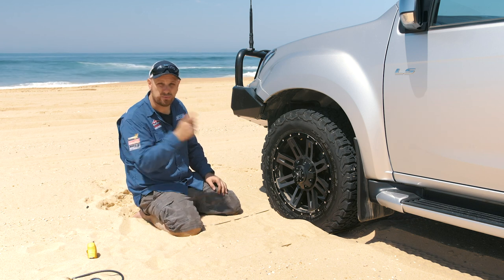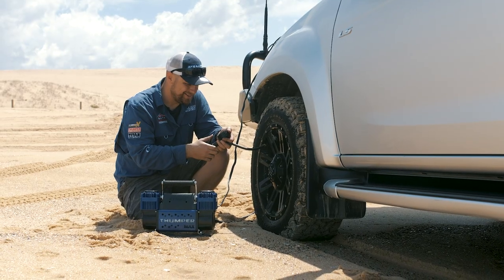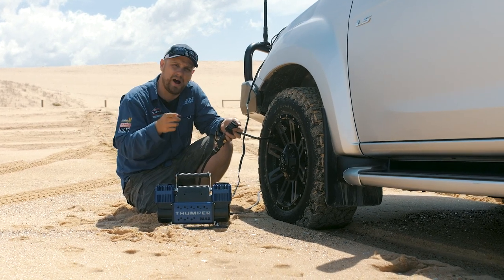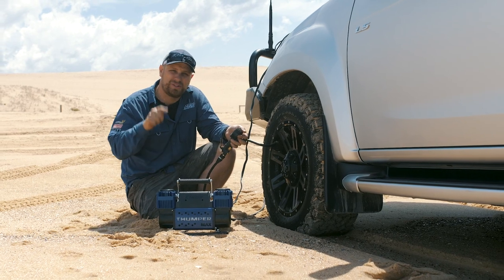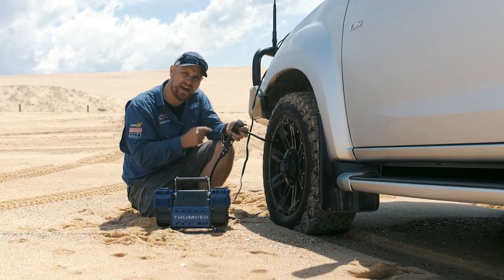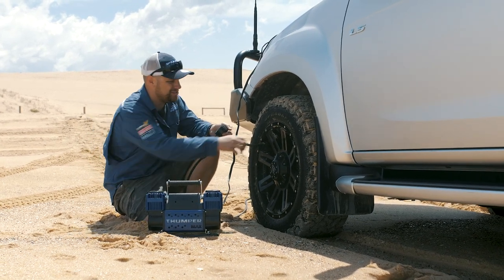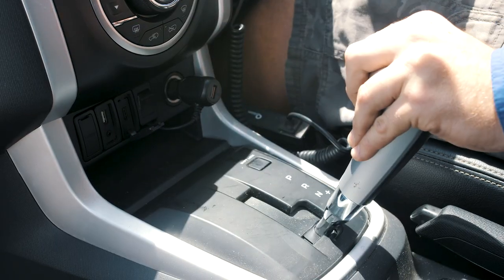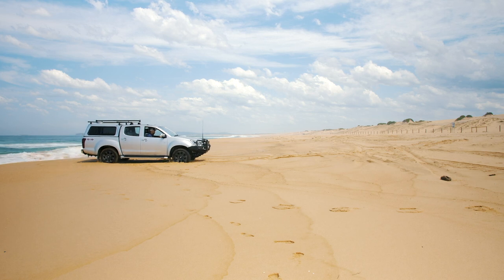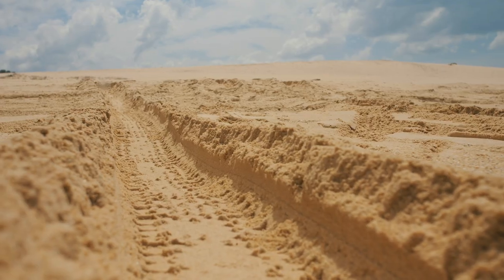What I want to do now is show you the real-world differences in vehicle performance between different pressures. So what I've just done is probably the most counter-intuitive thing anyone has ever done for driving on a beach — I've pumped all four tires back up to 36 psi. That hill behind me doesn't look tough, but it's actually super, super soft. I'm going to drive it three times: once at 36 psi road pressures, second time at 26 psi, and then finally at 16 psi, so we can clearly see the real-world differences. Car's in first gear, low range, holding about 2000 rpm so we can see the difference in tire pressures instead of relying on vehicle momentum. Straight away she's struggling hard — no chance — and this is where I'm going to stop so I don't get completely bogged. That is why you don't beach drive on road pressures.